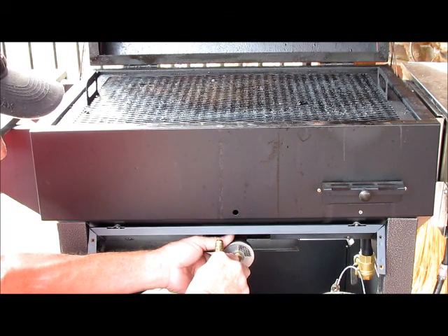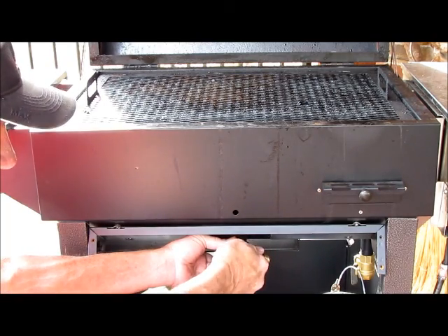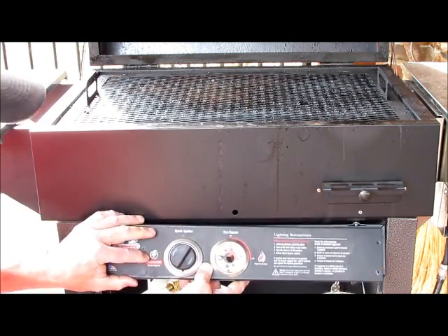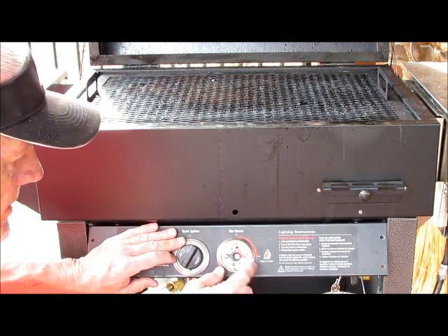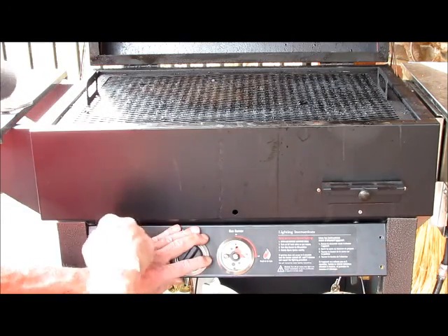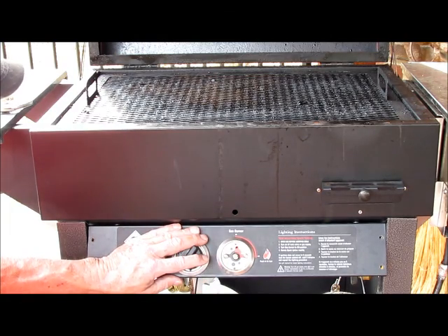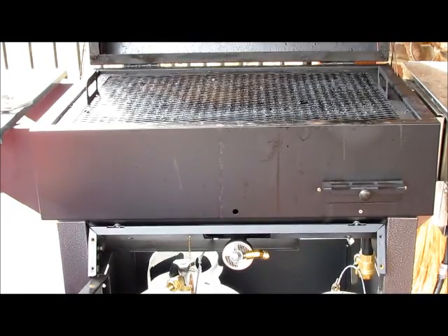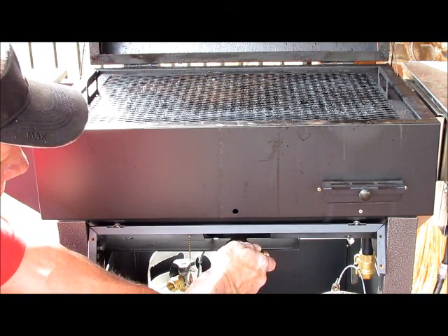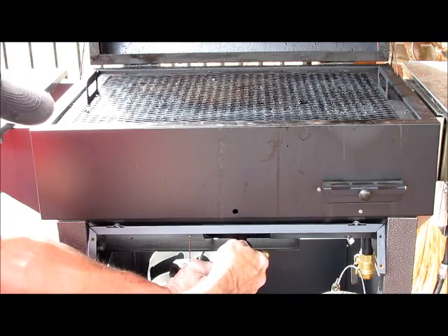Now, the same thing — pull down on your burner a little bit as you tighten this up. Screw it all the way in. Once it's in about the position, before you reconnect and tighten everything down, grab your control panel and slide it on there. It may hang up on the hole a bit, so you can still turn the gas valve a little bit. Make sure your screw holes are lined up and that the stem of the gas valve doesn't get caught — that it moves in and out freely. Once you know that's the position you want it in, tighten it up, then tighten the lock nut behind it so the gas valve won't move. Hold the gas valve with your hand and make sure everything is good and tight.